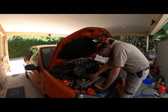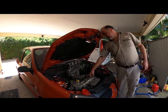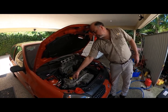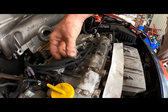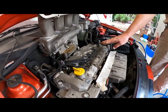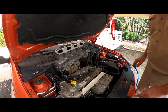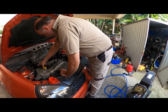Look at this. Even these heads, they've got the coil pack. I didn't realise, but see, show everyone this. They're already drilled and tapped to receive the coil pack. They use that bolt hole there for the phaser solenoid, but this one and that one, they're all already drilled and tapped to accommodate it. The problem is the height, and the plug fouls. Obviously they didn't want to be rebuilding top covers specifically for this, so everybody gets the same top cover for the motor. All right, let's pop this back down.